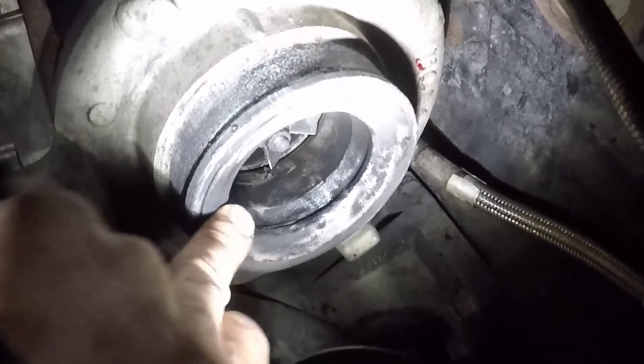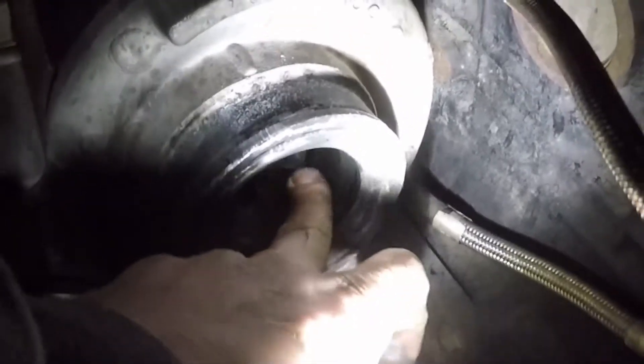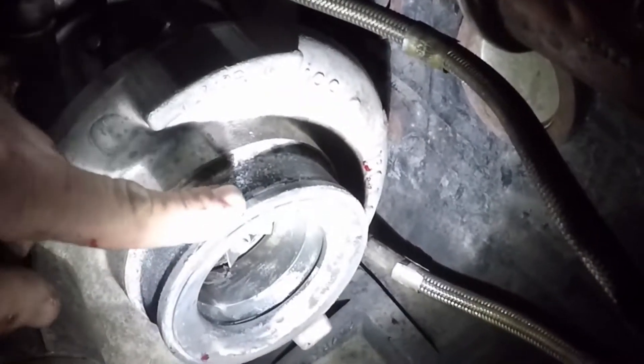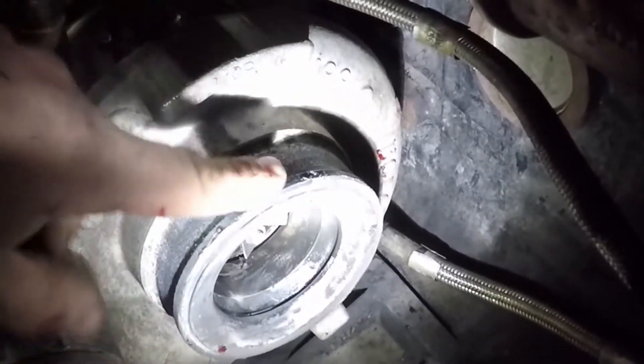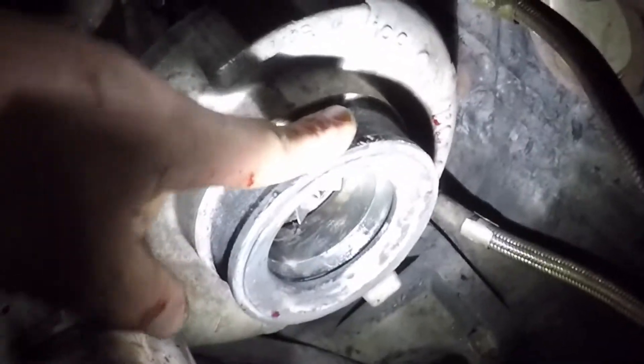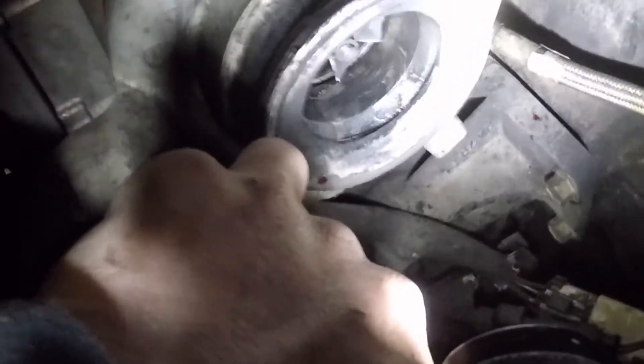See all this crud on here, all this oil and gunk? That's from having this crankcase breather going back into your top end, blocking it off and just putting a filter on here. On a 2010 to 2012 fourth-gen it won't throw a check engine light, and I believe that's the same for the earlier 6.7s. On the newer trucks I heard it will throw a code. But anyway, that's what you don't want — right there on the turbo. Seems it's been fine, but moving on.